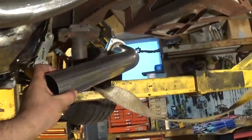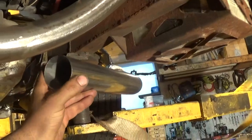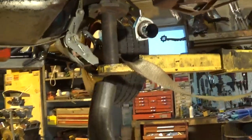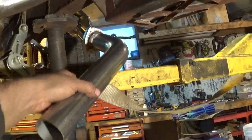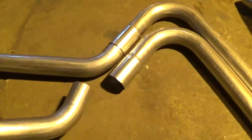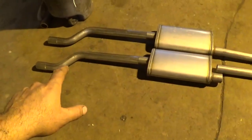I kind of realized I'm jumping the gun here - I cut off two of these pipes and started working and then I laid out all the pipes and realized that this kit is pretty much for standard headers, where you're coming straight back. Because I have fender wells on here I'm going to end up kicking it in and then back, which uses another bend. I had trimmed both pipes - one for each side - and as I was looking for my next one to cut, I realized that the ones I cut were the only ones that matched the angle for the hump to go over the rear axle.